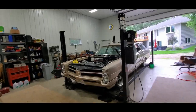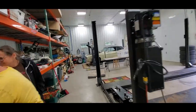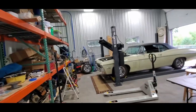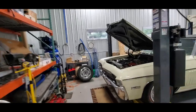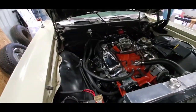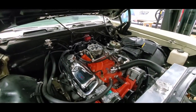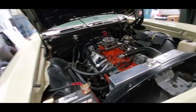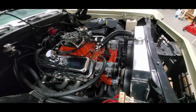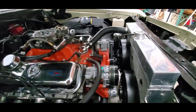Okay, while this car is cooling, I figured, crap, I haven't started the Impala in ages. So we're letting her do a heat cycle. We're still a little worried about the compressor. It blew a lot of PAG oil out. So at some point, I'm going to pull the compressor when it's over there, empty it out, measure the oil, see if I can find out how much it's supposed to be, and we're going to try to save this peanut compressor if we can. I really, really like this Front Runner system though.